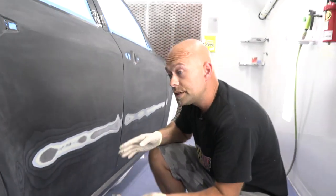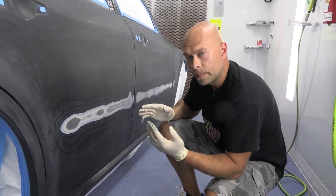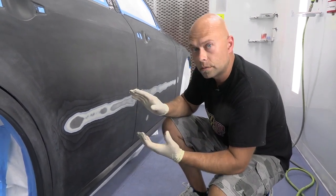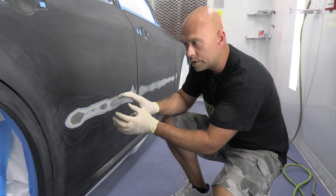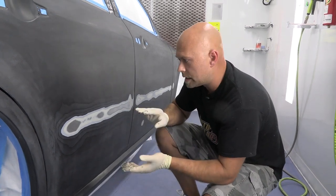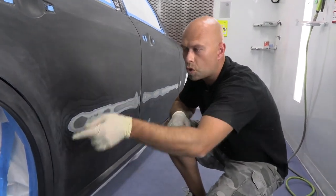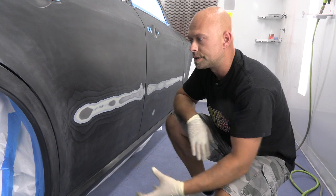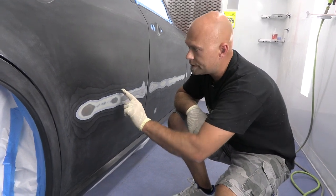One of the reasons our paint is going to work well here is our autoborn sealer is non-reactive. If you're hitting this with a high solvent content primer, it's going to cause mapping — it'll swell up the underlying coat because it has nothing to grab onto. The tooth, that scratch, is very minimal. This is why I always stress: when doing something like this — motorcycles, bikes — use sandpaper rather than a scotch pad. Scotch pad is good for edges, corners, and creases, but anything broad and flat you can get to with a DA is always best. It puts a better tooth, a better scratch for the paint to bite into.